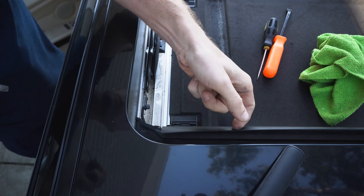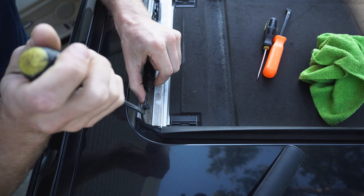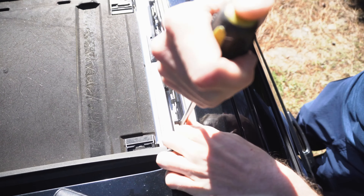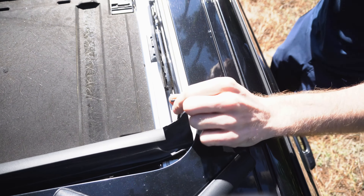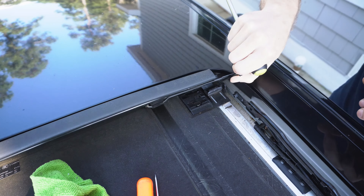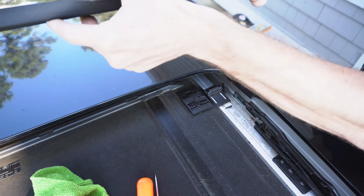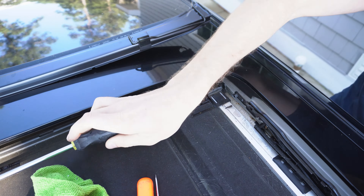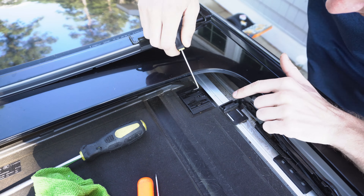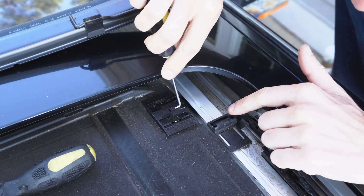This project is going to be really simple. We're starting from inside the car, pressing the roof button, tilting the roof, then sliding it back all the way. Remove that little rubber piece — it slides out from the glass portion. Taking a closer look, we have a couple of T25 screws, and from this perspective we're going to be able to lift the glass part.